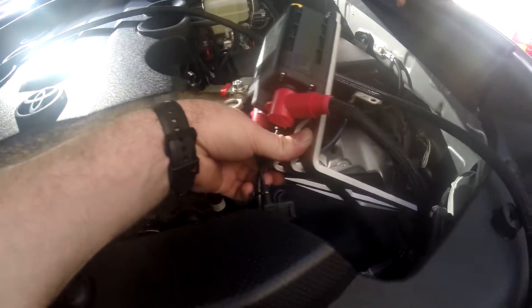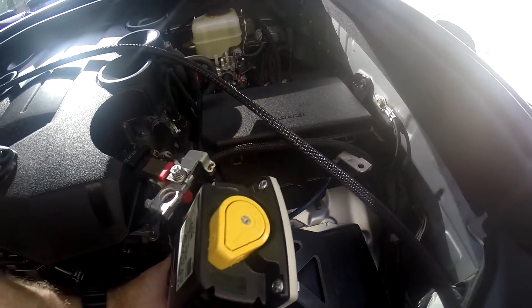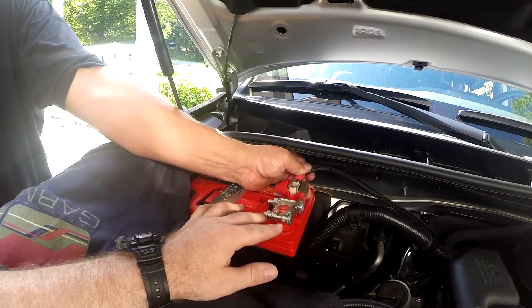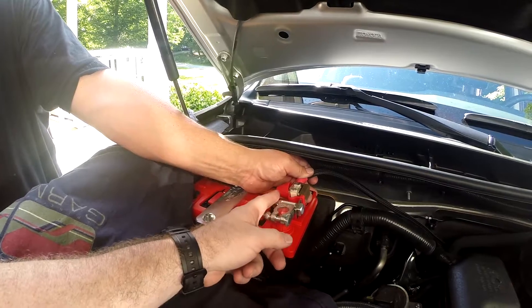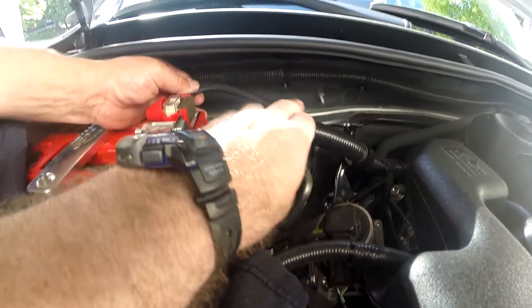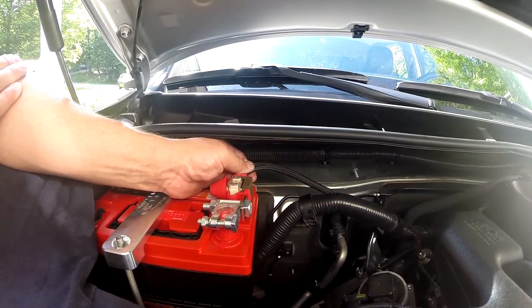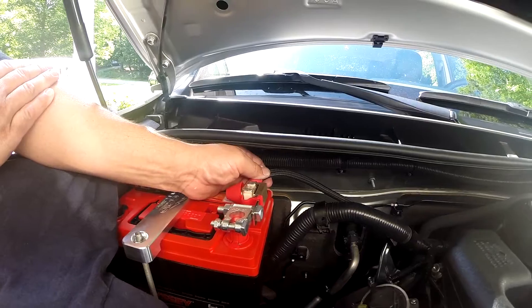We have the wires on the bottom of the switch and have dry fitted everything in terms of routing, so now we're going to set this down in here and start to get things snugged up. We spent a little bit of time coming up with the best way to use these terminals — we decided to put the coupler on like this and angle the fuse to the inside to keep it away from the exposed area down to the ground. That gives us plenty of slack to run the wire up and zip tie it to the other wiring harness up there. The importance of the fuses is that if the main power lines get grounded from abrasion, an accident, or something similar, the fuses are going to keep you from having a fire.